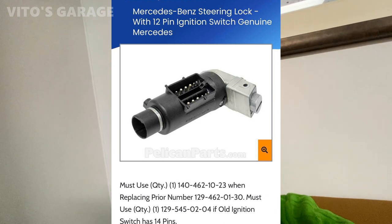If it doesn't turn, you're probably going to have to do the same thing Dennis did in this video. If you're just trying to replace the tumbler because it's worn out but you can still turn the key, you're still going to have to drop the kick panel — there's no other way of removing it because there's a black metal barrel surrounding the actual tumbler. So you're going to have to drop the kick panel no matter what if you're doing any work on the W140 ignition lock system or cylinder. In some cases you might have to remove the cluster just to get better access. If you have any questions, contact me or Dennis — thank you so much, don't forget to save your classic cars, and I'll see you in the next one.